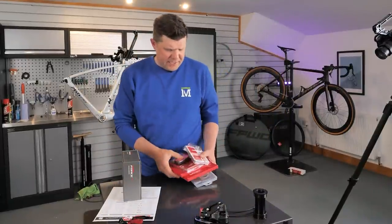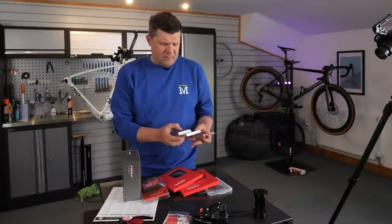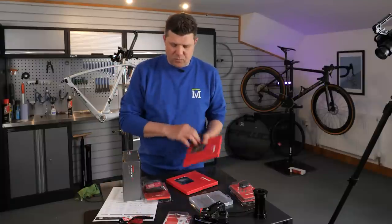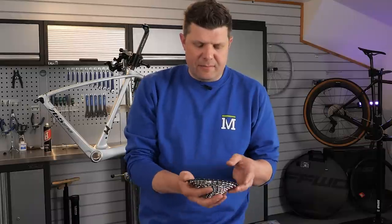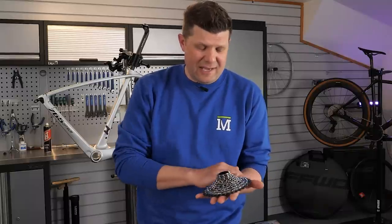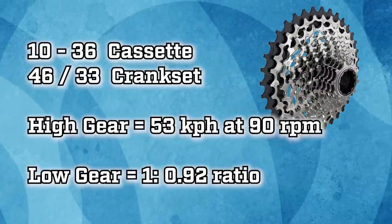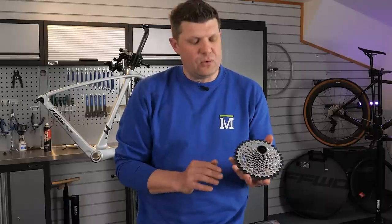Then all the little bits and pieces: we ordered the right size bolts for this frame but didn't need them because they came in the packet. We also got two batteries — the same batteries across all SRAM components. There's the SRAM flattop chain, brake disc rotors — we've gone for 160mm floating rotors — and this is the cassette, 10-through-36, which works fine with the rear derailleur. Going up to Red you lose a bit of weight but lose some versatility in gear ratios. Paired with the 46/33 front chainrings, we get a beautiful low gear ratio without sacrificing much on the upper end — perfect for the hills of North Wales and beyond.